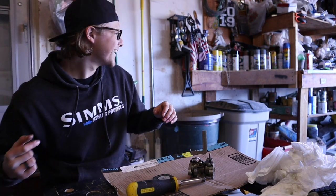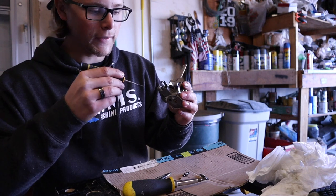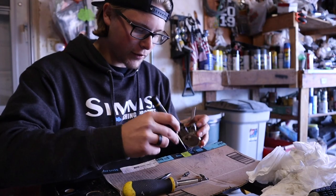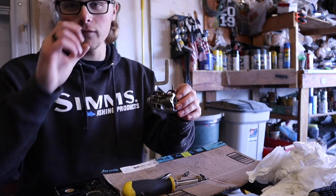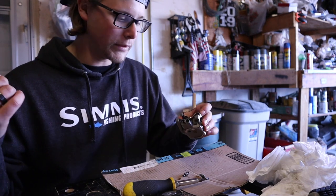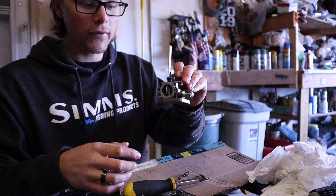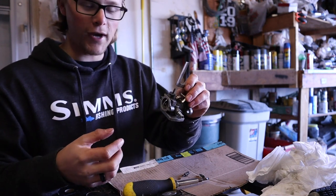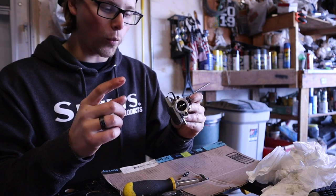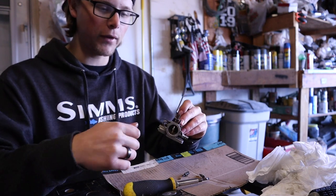Half and then half of a half, so three quarters. Now that we have those recorded, we're going to take them both all the way out. Important: on the inside of these there are little gold washers — you're going to want to make sure you don't leave those in when you soak in the tank. Now that we have all the plastic parts out and everything that would stop carb cleaner from getting into every single orifice, I'm going to grab the tank and plop this baby in. You don't have to worry about taking off the metal parts — it's not plastic, it's metal. It's going to get into every nook and cranny and clean everything out. Then once we get it out, we'll do the exterior brushing with an old toothbrush, put wire through every little hole, spray everything with carb cleaner, then use compressed air to clean it all out.